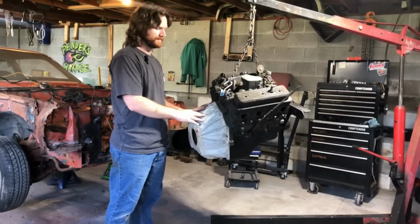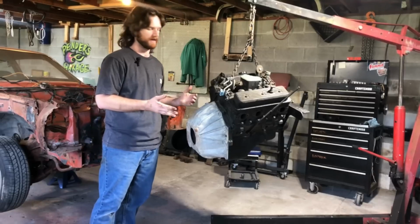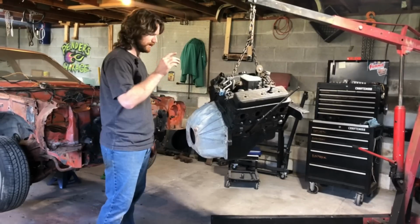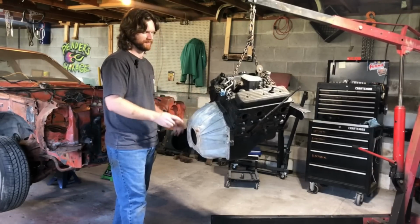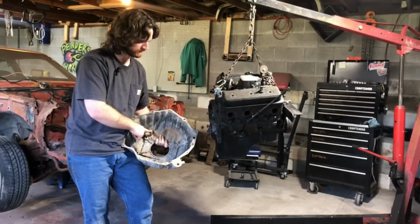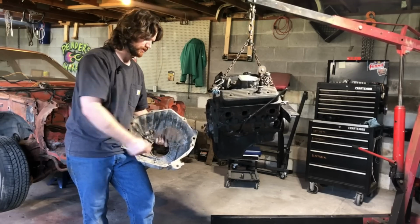This is the bell housing that you want if you're going to keep the cable actuated clutch on a Vega. So this is a Chevy Monza V8 bell housing. I'm not going to use this. I was lucky to come by this bell housing. I have not been lucky enough to find the clutch fork. The pivot ball is here instead of the traditional location right here. That allows you to reverse the actuation so that it pulls it instead of pushes it.